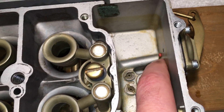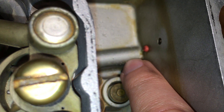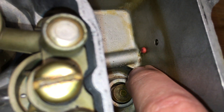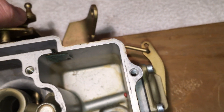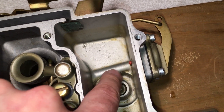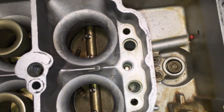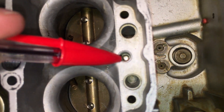Next is the accelerator pump. There are a few holes here. The inlet is actually the lowest hole — it's below that red thing; it's hard to see, but there's a hole underneath there. That's where fuel goes into this pump. When you step on the gas, the initial stroke moves the accelerator pump and pushes fuel out through this passage, which goes into the center screw of the booster venturi. That passage ends up coming out here, and normally there should be a little check ball in there.